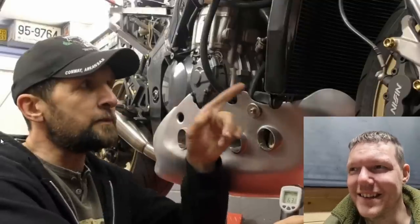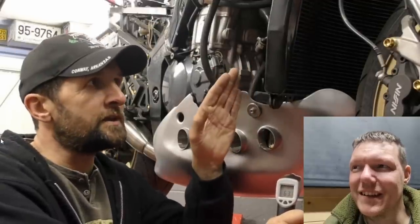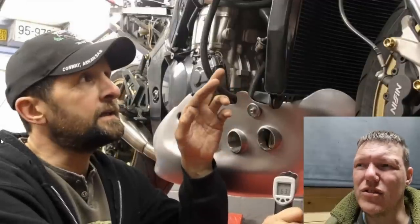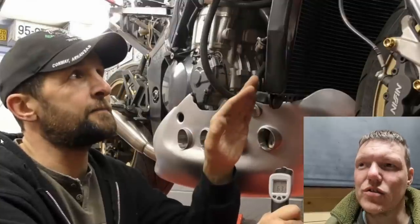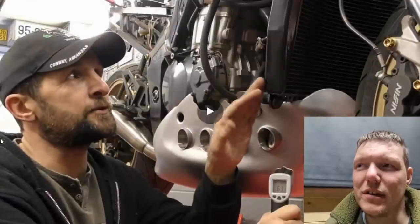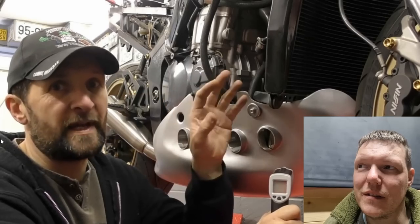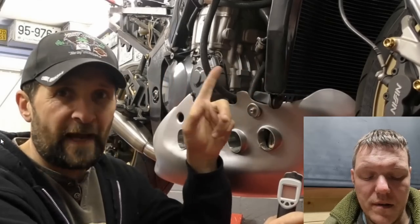That was running at about 110 at the peak, which shows that the Evans waterless coolant does run higher than boiling point. So does water, because it's under pressure. The radiator was up at 110, so it's chucking out the heat. It's effectively dispatching the heat out through the matrix. You heard the fan kick in over and over again.